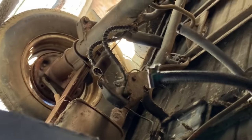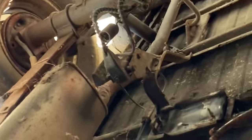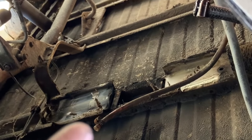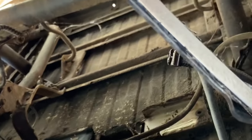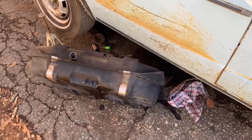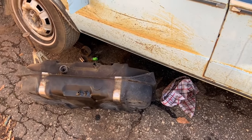And so actually pulling this tank out, you've got your two straps that bolt on. You got your two lower fuel lines. You've got a vent, another little vent at the sending unit lines, and then the filler, of course. So pretty straightforward drop, not too terrible to do. We got this thing out, let's go ahead and try to pour what's left in it out, flush it a couple times, get it bolted back up in there, get some fresh diesel in it.